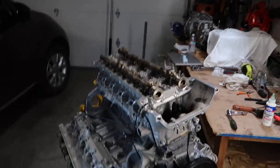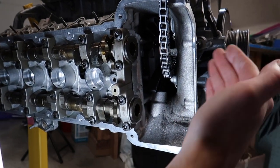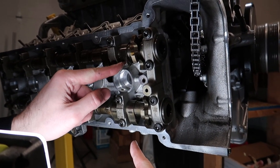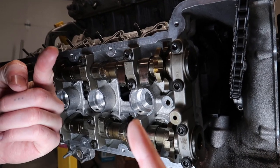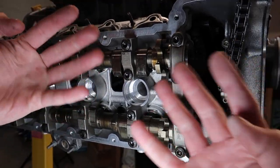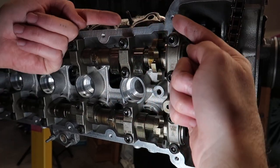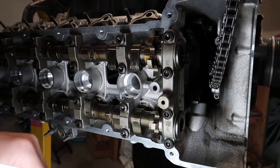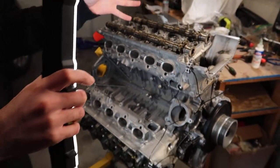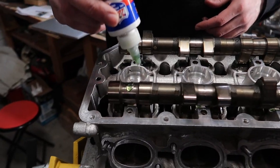On the other head, you can see since this is piston 1 through 5, right? Top dead center means piston 1 is all the way maxed out. And these lobes, the intake and the exhaust lobes, are completely on opposite ends. See that they're facing up, the digits are facing up, but when the gears up here, the vanos, are gonna be turning, these guys are gonna be going that way, and these are gonna be going this way. So the firing sequence is supposed to be very important here. Okay, so just don't confuse that and make sure that it's properly set up. And if you put them on this way, it wouldn't hurt to give it a little bit more lube, just on everything.